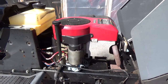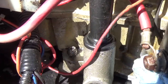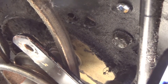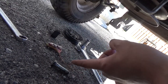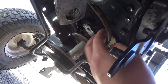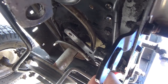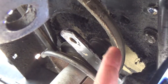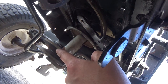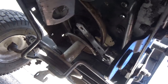What I've got to do is remove the engine completely, and I'm in the process of doing that right now. There are three or four engine mounts — one right there, another one back there, and a couple on the other side. To get access to these bolts, I just had to take the 9/16ths bolt out of that pulley. Once I got that off, I pulled it right off, so now there's enough slack to wrap the belt around and pull the engine straight up through the hole, which is actually bigger than your deck pulley. You don't have to remove the drive and deck pulley stack — you can pull the engine with the crankshaft and pulley stack all up through there in one piece, which is nice.